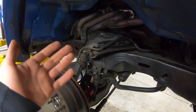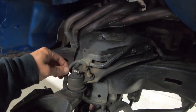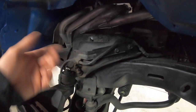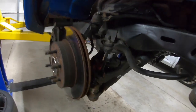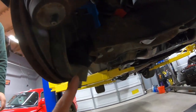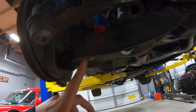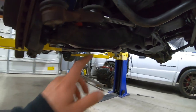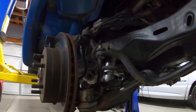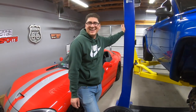The truck's up in the air, wheels are off. We're going to see if we can do it with the least amount of work possible. There's a couple bolts that hold this whole bracket with the brake line, so we're going to remove that. The lower control arm - the nice thing is the ball joints have already been replaced, so it's already got bolts there and we don't have to press out any ball joints on the lower. It depends whether we want to do this on the floor or hanging from the vehicle. Let's try to do it as easy as possible - typical Jonathan fashion.